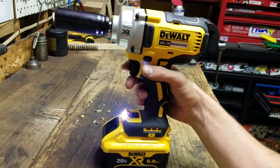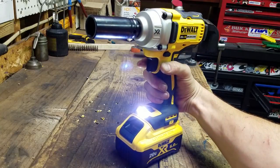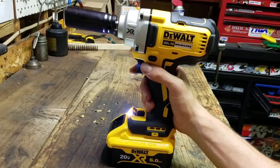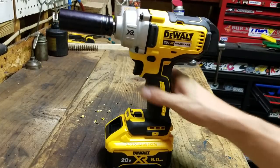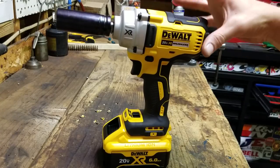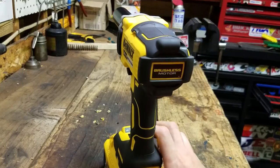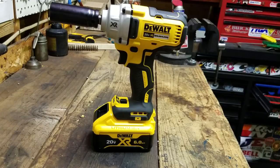I'm kind of rambling now, but I know I like this. It's solid — it's damn solid. 330 foot-pounds, you're not going to run into too much stuff that's tighter than that. If you do, you've got bigger issues and maybe you need one of the thousand foot-pounders. But I think if you ask any auto mechanic with three different ranges of impacts, they're probably using this one the most, because it's going to handle everything and it's not so big and bulky that it won't fit anywhere. That's it — the DeWalt XR 20-volt brushless lithium-ion impact gun. Check it out, I'll leave a link in the description. Thanks for watching.